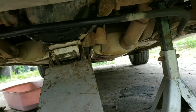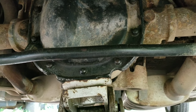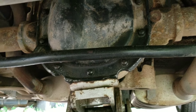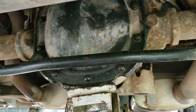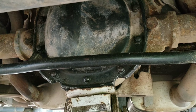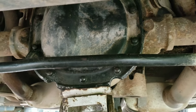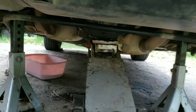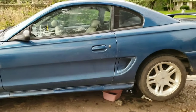So what we're gonna have to do in order to get to that inner pinion — we gotta open up the differential, this is gonna be like the third time I open this thing up again. So I'm gonna open that up, drain all that fluid out of there, take these axles out, and then remove the gears. I'm gonna remove the whole gears out, hopefully nothing comes apart, but if so that's gonna be even more work. Then we'll get to that inner pinion and hopefully get this thing fixed up and get this noise stopped.